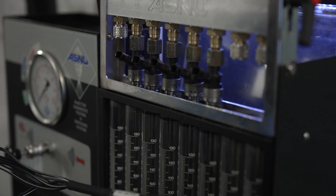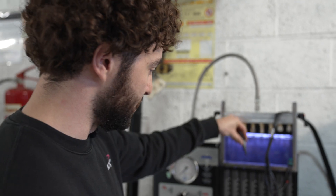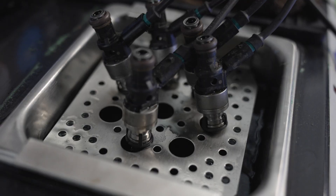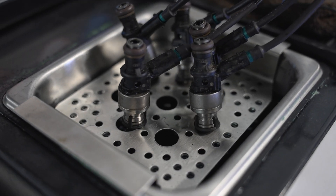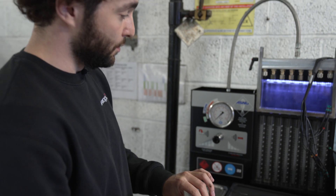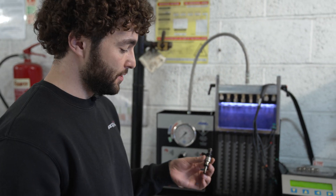What we have here is a brand new fuel injector cleaning machine. We put the factory injectors into the machine and it runs a test so you can see exactly what the fuel flow volume is. After that, we put the injector tips into an ultrasonic cleaner to clean them out, taking them from something dirty like that to something clean like this. Then we put them back in the injector machine and test again to make sure everything is balanced.